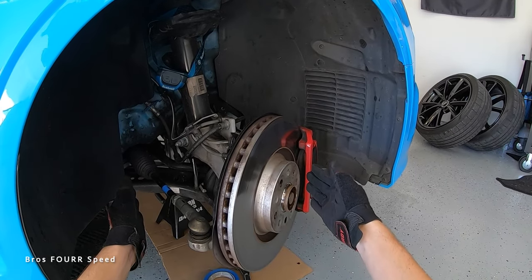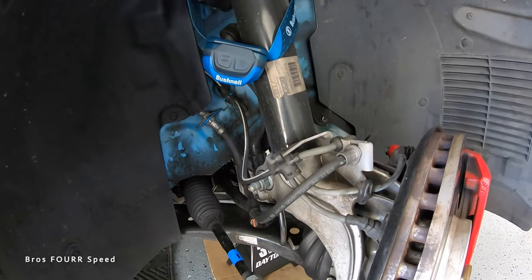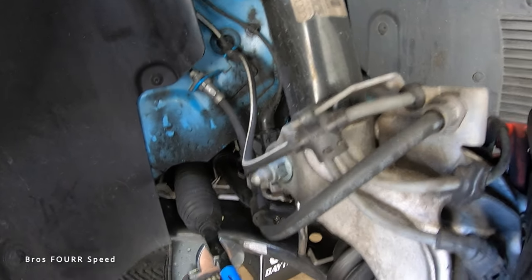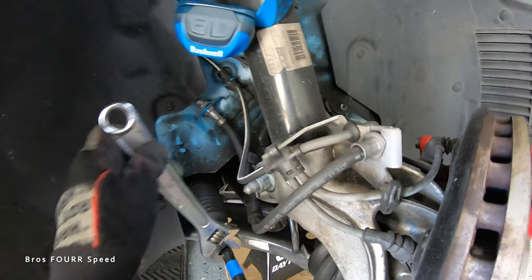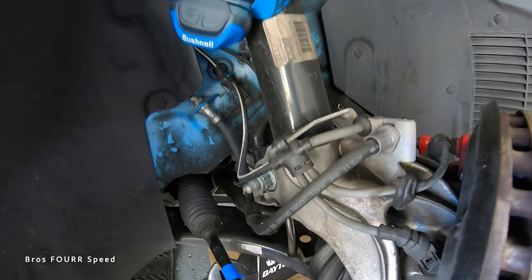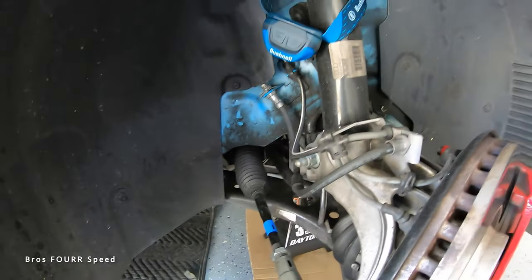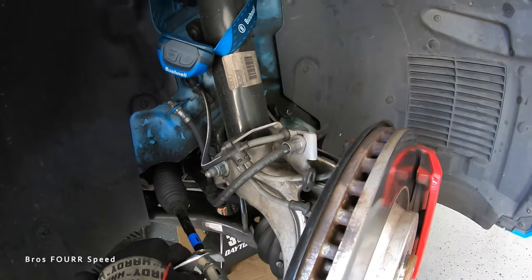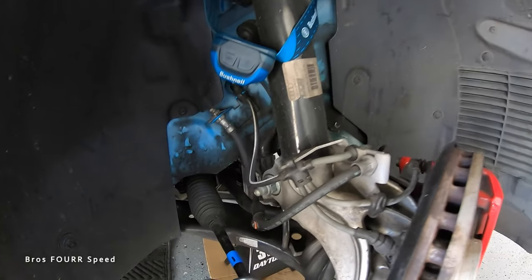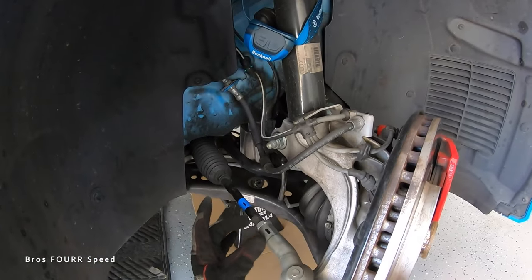Over on the driver's side, the rotors were aiming to the right when the steering wheel was straight, so I tightened that side to pull it left — pushing the tie rod end inward. On this passenger side, I want to expand it just a little bit, so I turn it in the opposite direction from the driver's side — one full rotation to expand the joint. It's very important to do the exact same number of rotations per side. There we go — level — and I tighten the nut back.